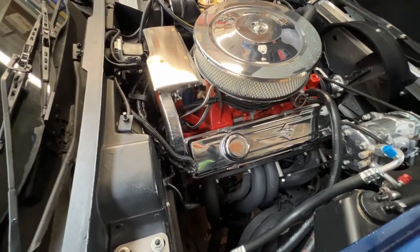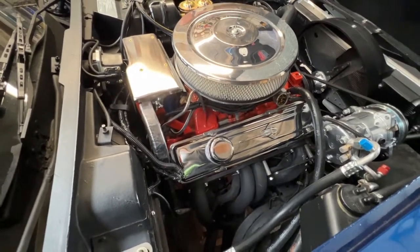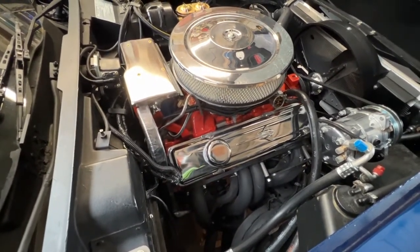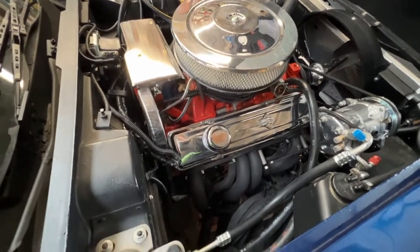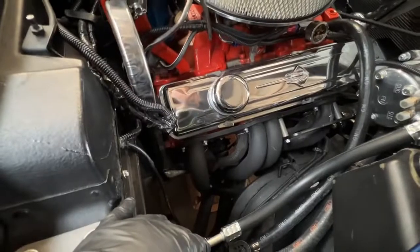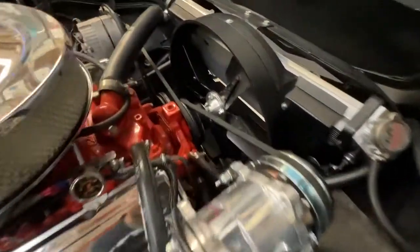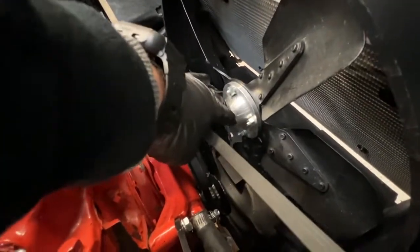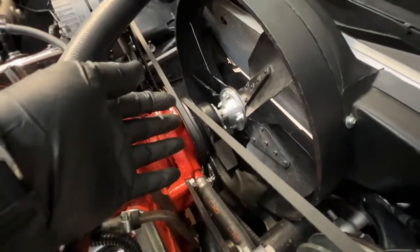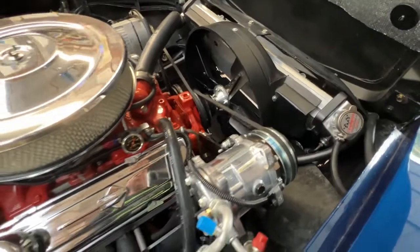It's the brain of the system. And by moving the selectors, it will open and close different flap doors to move air where you need it, or to turn on the heat and turn off the air conditioning system. On this particular model, we installed a clutchless fan adapter so that we improve the flow of air through this system.